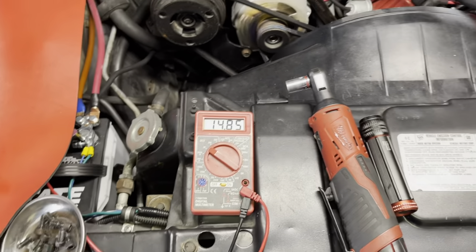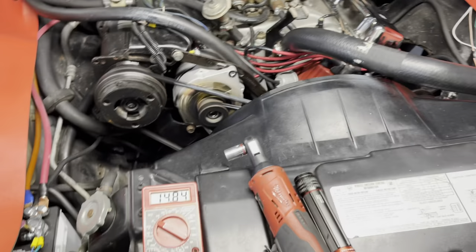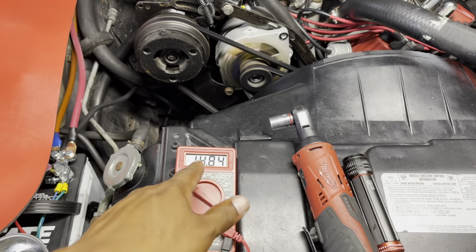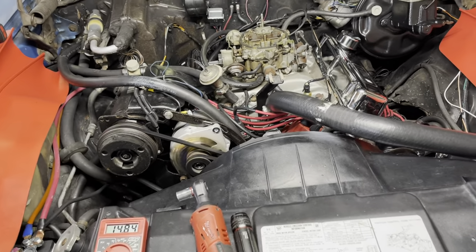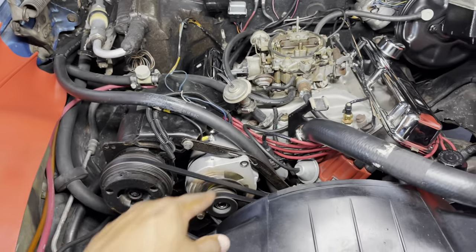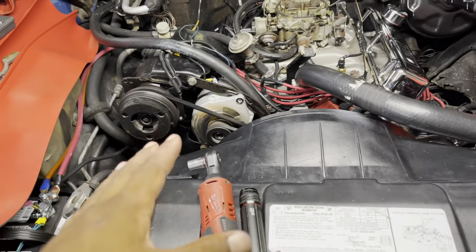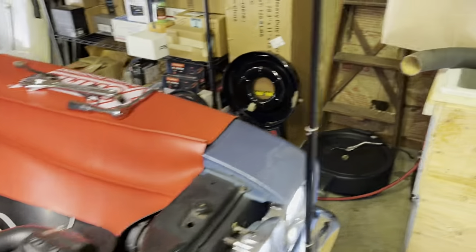Alright you guys — so right now I have the car idling, the fan on, the heater on, and I wanted to see what the volts were at. It only dropped 0.15 volts. Before I had the heater on it was right about 14.99 and it only dropped very little. So it's safe to say that alternator is working. I would assume that my ground straps and this 2-gauge wire running on the positive all the way to the back of the alternator is also probably helping. I'm really glad I did that — it seems to be working just fine and charging great.